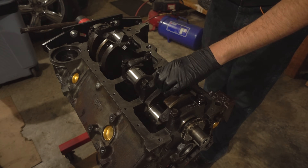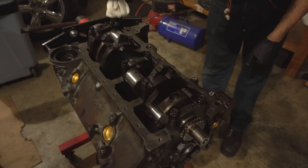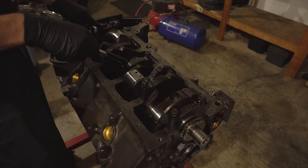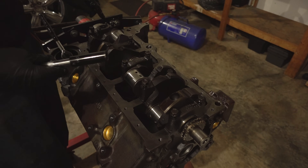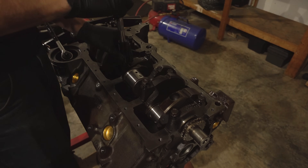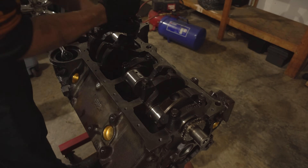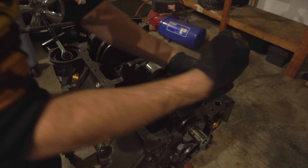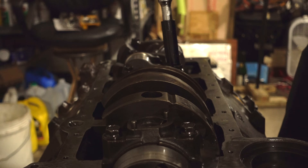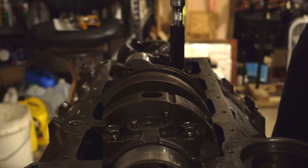This time you can rotate the crankshaft because you don't have to worry about messing up the plastigage. One thing to note: I've heard you want to have the oil pump attached and tightened if you're trying to be really precise with these specs, since it will change what's going on with the rear bearing. Plastigage isn't that accurate an instrument anyway, but just something to keep in mind. Now we'll go through again at 30, 50, and 70 ft-lbs. I've seen 65 and 70 as the torque spec — I've seen 70 more often, so we're going with that.